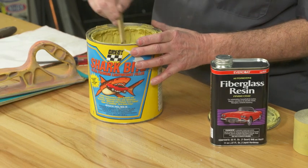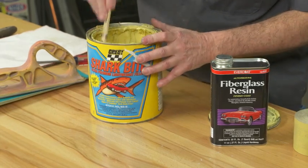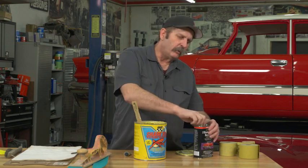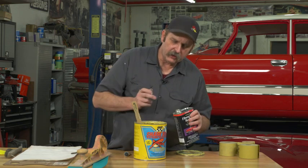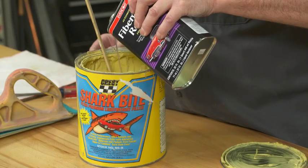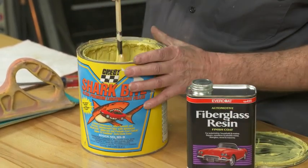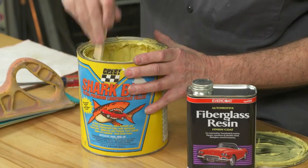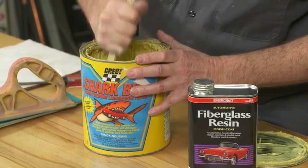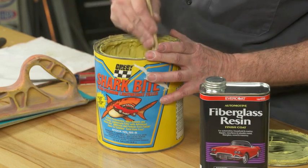You've just mixed it on top and taken the resins out of the can by only stirring the top. What you end up with is a hard brick. The way to get around that is to take some fiberglass resin, pour that into your body filler, and then mix it. You'll find that loosens up the body filler.